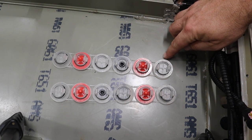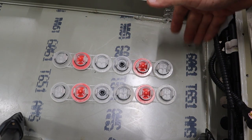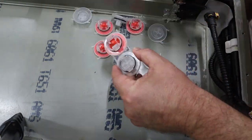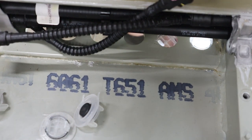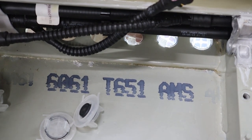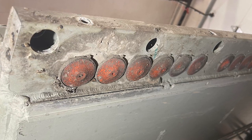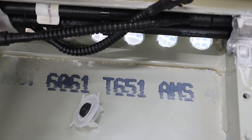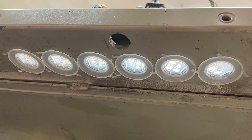The strips have three plugs on each of them, and I want six plugs for the front two compartments to completely fill them up. I'm going to cut these apart, get the six plugs, and use those six solid plugs on these front two compartments. These compartments 7 and 10 are directly behind the front wheels, so even though the battery box is up with a cover over where these valves go, it's still a spot that can easily get dirty. Those valves can fail, and then you can get moisture into the battery pack — which is what caused all the trouble in the first place. So these are going to be completely plugged up. Here's what those plugs look like looking up from the bottom of the battery pack.